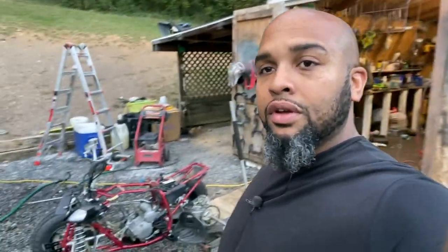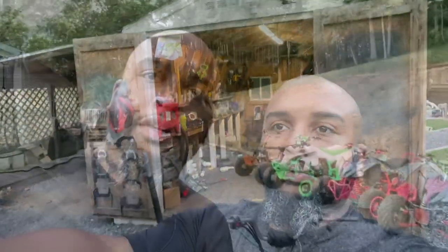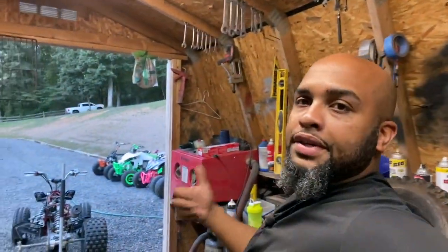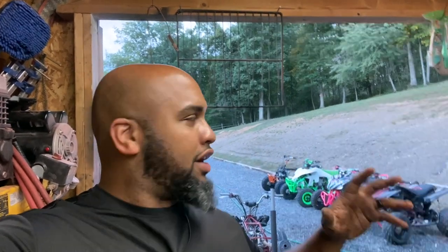What we're gonna be working on today is the Raptor 250 project. As you can see, we have a tire off right here up in the building and the tire changing tool was sitting in there. For those of you who don't know, the Raptor 250 came to me as a project that is going to take a lot more than I originally thought. We thought it was gonna need carbs cleaned and had some electrical issues, which is what the prior owner stated. However, once we got to digging into it, spark and everything was fine. It would not fire with no gas, then a compression test showed no compression. Took the head off, found a bent valve — an OEM one is coming in the mail. The piston had also broke loose, so I had to split the cases. Yada yada yada, we have all that back together and it's installed in the machine.